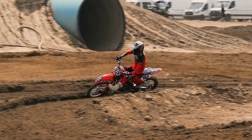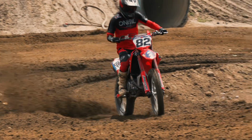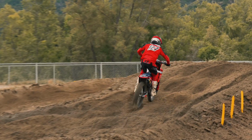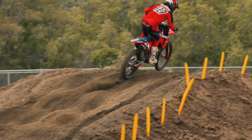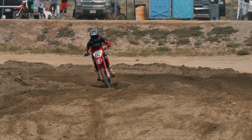Okay, one of our other test riders, Cody Moore, jumped in and got some laps on this thing. Now, you're more fitted to what this bike is set up for, 140 pounds. How did it handle for you? Let's start there because you're a better test of the suspension. Yeah, whenever the corners were a little bit slower or it was a bit more technical, the suspension worked better. But anytime that I came in super fast into something with a lot of chatter, maybe I could stiffen it up just a little bit. It was a little low in the stroke maybe, but I didn't want to push it too hard just because of how it felt.